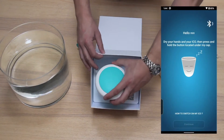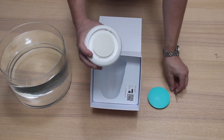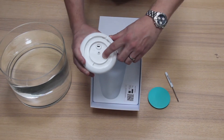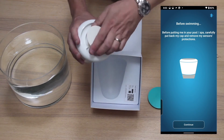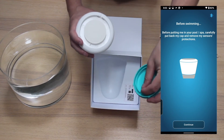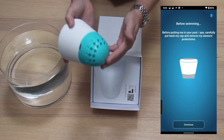Take the Eco unit and open the lid using the lid tool. Take out the safety cap, and then press 3 seconds on the on-off button until you get a green light. Place the safety cap back on by aligning the notches, then place the lid back on by aligning the notches again. You should hear a click, indicating it's perfectly waterproof and closed.